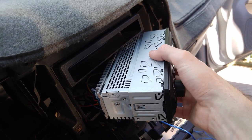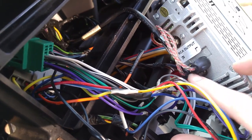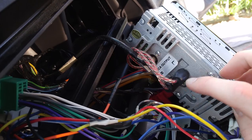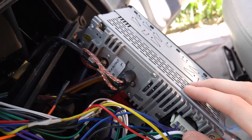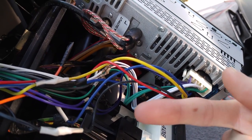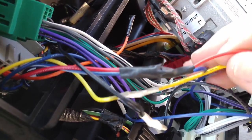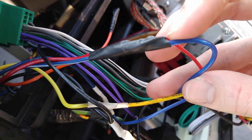I've started to pull out the dash panel — you can see my radio here. Pulling it out a little reveals the L and R RCA output cables you'll need. This is only if you have an aftermarket radio, which will have a red and white output. If you don't have an aftermarket radio, you'll have to wire power and negative to each speaker. If you do have one, go into the wiring and find the turn-on wire — I've identified mine here, soldered the positive and negative together. This wire from the kit tells the sub when to turn on.